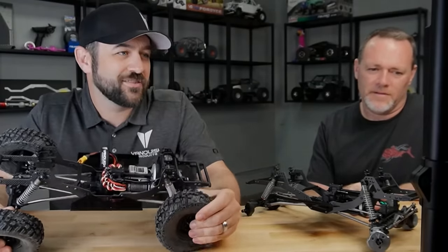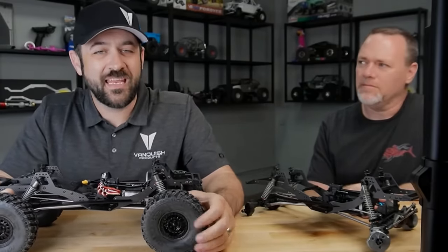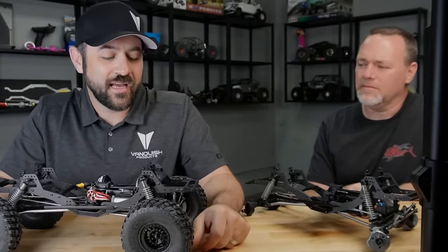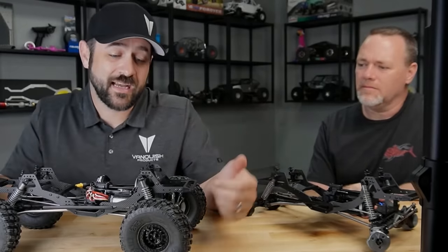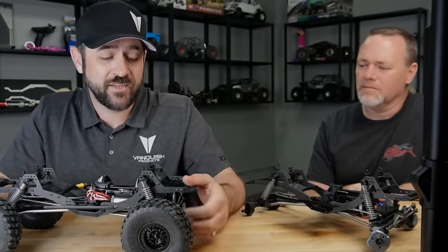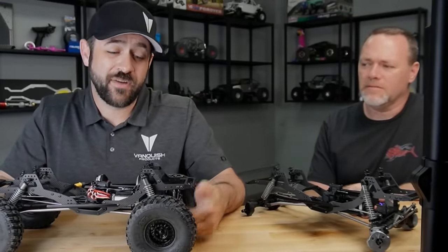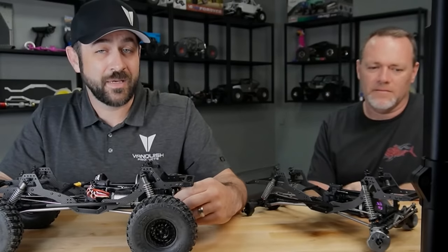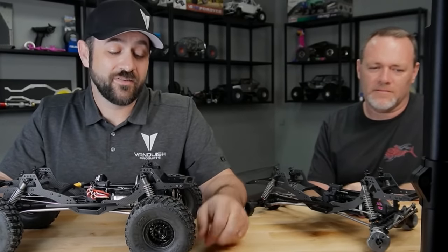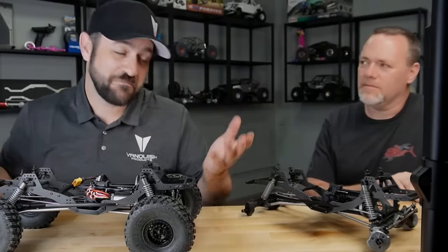Any recommendations on how to stop breaking a portal axle shaft? I haven't had much breaking. I broke a pin not too long ago, but I've got my steering stops taken off so I can steer way past the typical operating range. If you're breaking very often, check if you're pushing the operating range of the universal with steering angle — that could be the biggest cause. Beyond that, too much power.